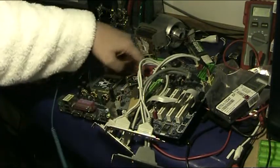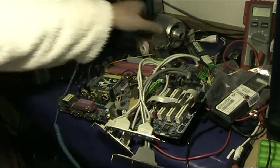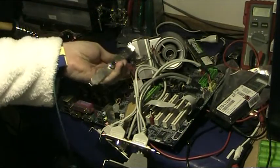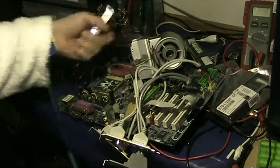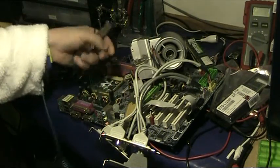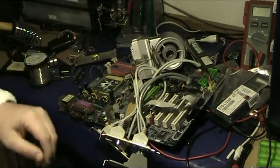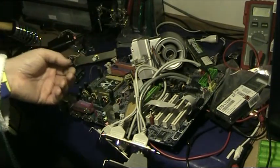And there's another fan to keep the on-board bits cool. Some fan speeds are automatic; this one isn't, and there's a variable adjuster so you can control this one manually. But most systems, the fans are actually sensitive to the temperature, and they'll ramp up the speed of the fan. The fan's connected to the motherboard and as well as a positive and negative, there's a third wire which helps control the speed.